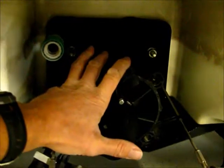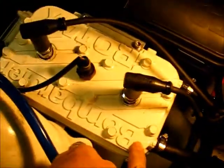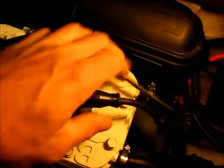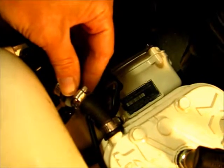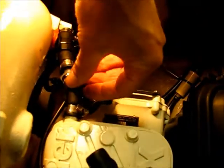Let's recap from the beginning. Water pressure is generated inside the pump housing, pumped up into this black box in the pressure zone, and moved through the black hose closest to the center into the water jacket head cover — you can see there's an arrow that says 'in.' It moves around inside of here, exits out here, and exits out to the front into this hose. It's shaped like a T assembly. So it goes through this big hose, and there's also a small hose down at the bottom there that water is traveling through.